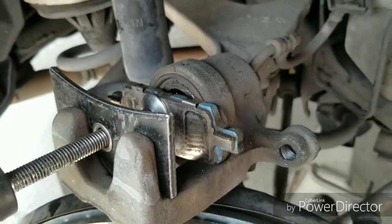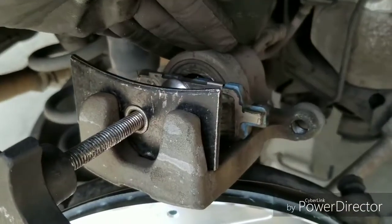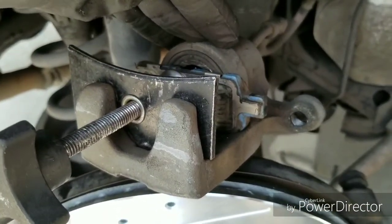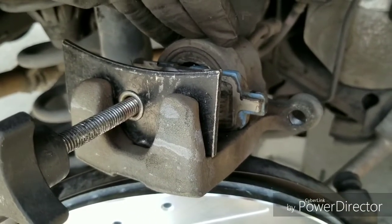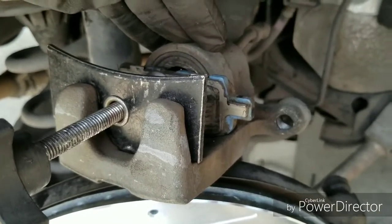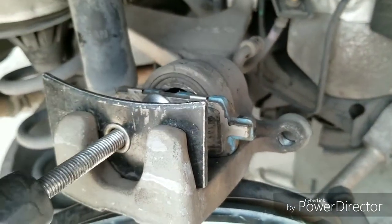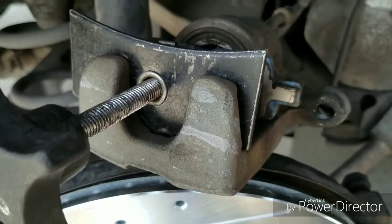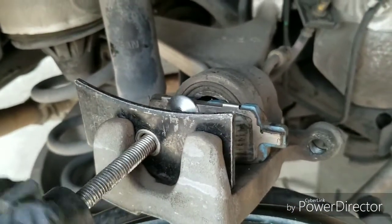But like I say, just twist until the piston goes in. You might lose a little fluid out of the reservoir, but that's normal. Don't worry about it. Just wherever it came out and whatever it touched, wet it with water. Pour a bottle of water on it, or if you can, shoot it with the water hose, because brake fluid does eat through paint and rubber hoses. So just run some water on it if you leak fluid out of the reservoir.